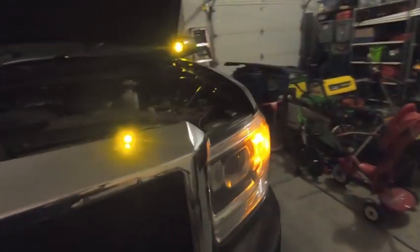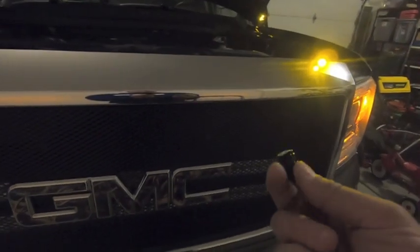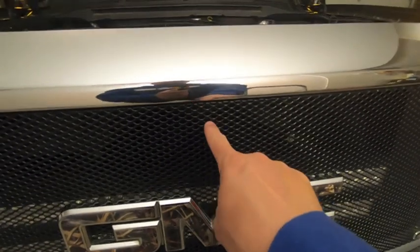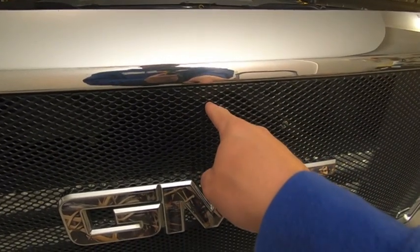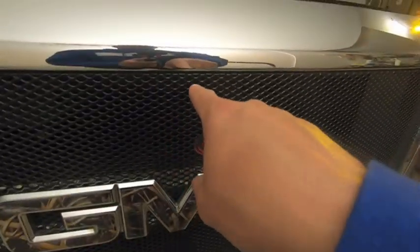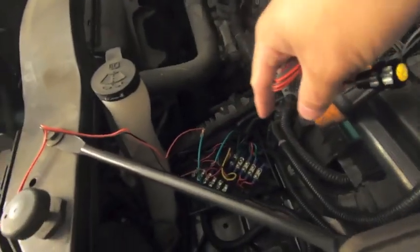If I turn off my light here, it matches really well with my LED pod up top. The biggest hurdle here is drilling the hole to make it fit inside this grille. My concern is drilling through metal mesh — if you use a standard drill bit you're going to catch on that metal eventually. I'm going to try a few different options. I'll put one light in the middle and one on each side, run the wires up in this little channel, across and down into my box.